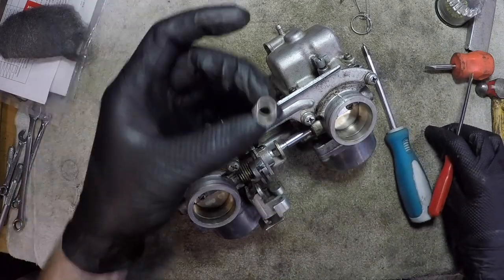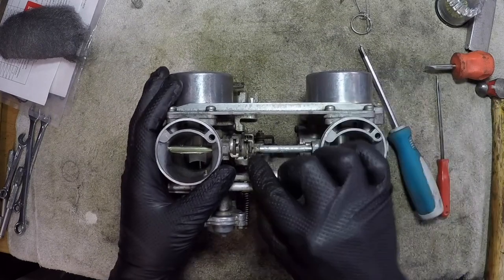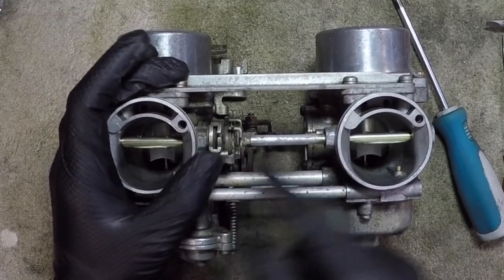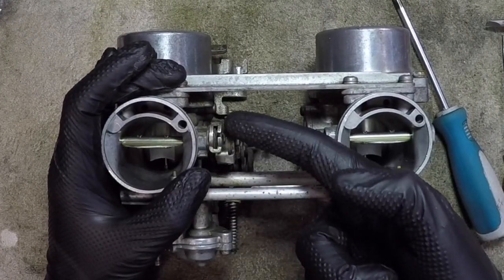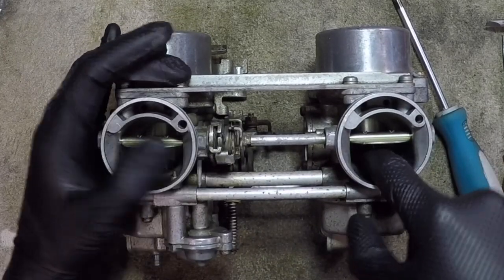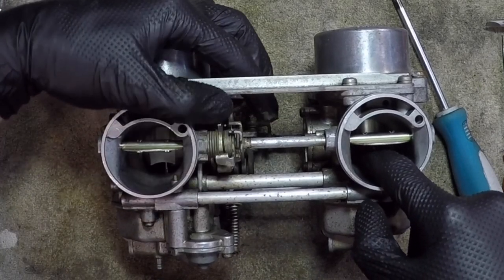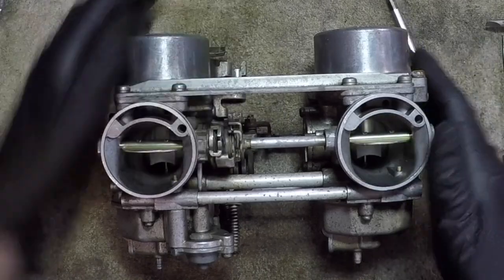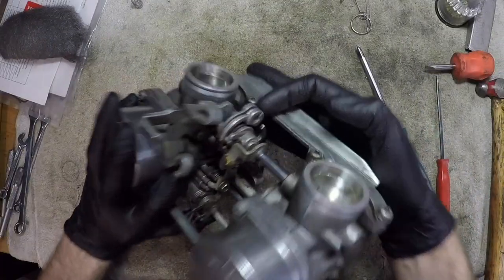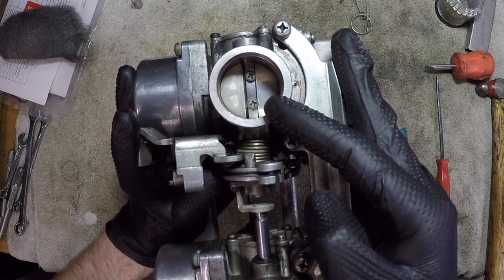But there's not too much. It's just really this spring here, and a smaller spring, a little clock spring, where this rod is actuated by this rod here. So this rod comes over, attaches to a little spring, and this rod helps function that. If I wanted to, I could put my finger here and just function this, but it's not doing anything. But what this is also doing is operating a little bit on this throttle here, which opens that butterfly up just slightly.